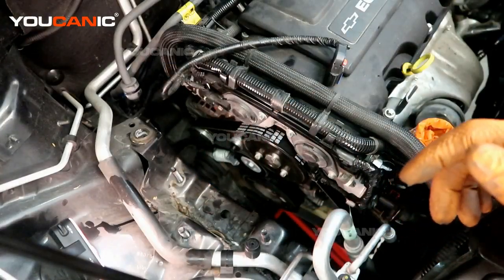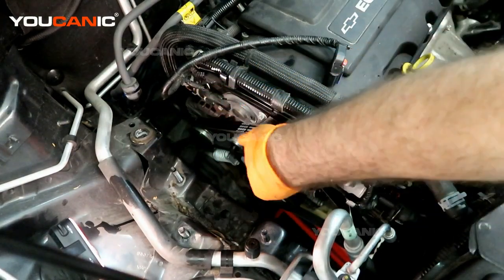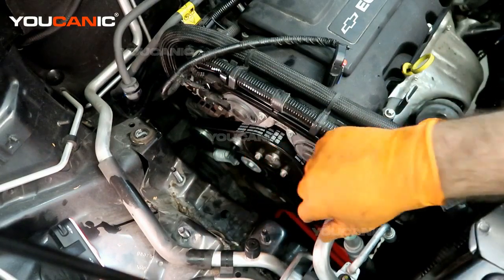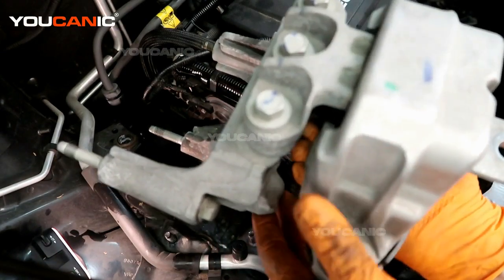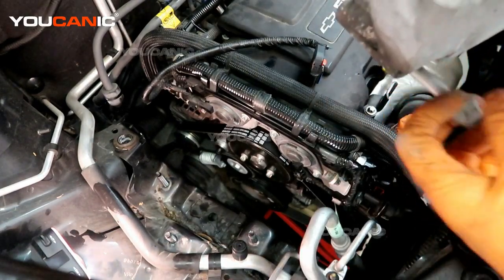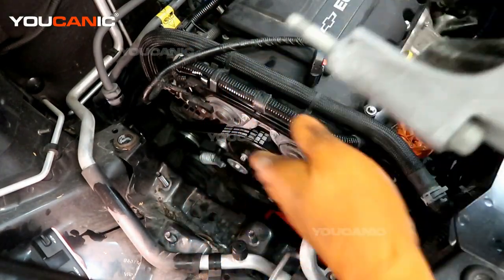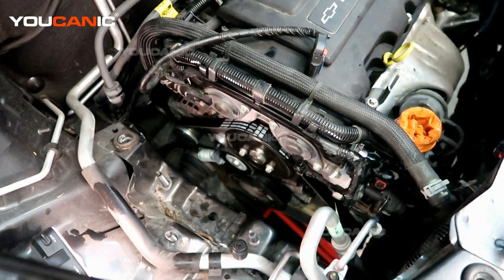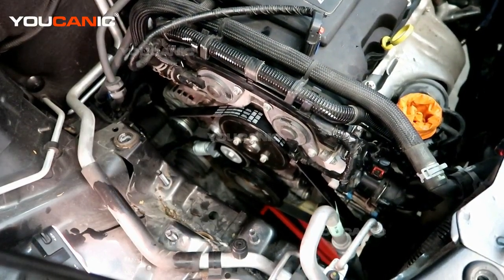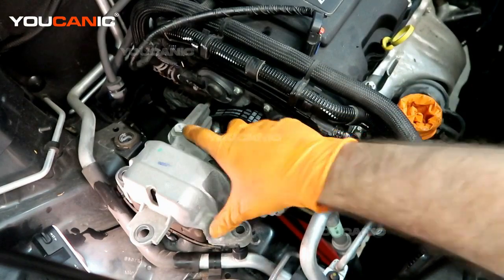We have the belt around all the pulleys, seated inside the ribs where they should be. Now install the motor mount and the bracket that holds it, since we needed to remove it to access the serpentine belt, tensioner, water pump, alternator, and all that. We kept it as one piece — you can undo the three bolts and have two separate pieces, but we kept it as one. The bottom bolt doesn't have to be in completely right away, but the two side bolts you'll want to have started as you place it down, because you won't have enough space to push them in otherwise. The motor is on the jack, so we need to raise the motor to get clearance for the motor mount to clear the side of the fender.